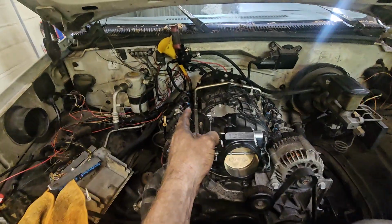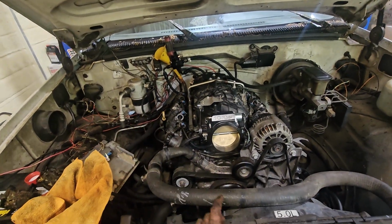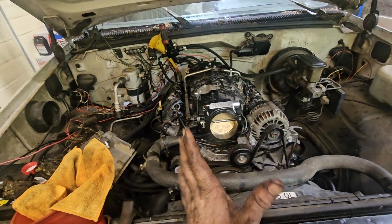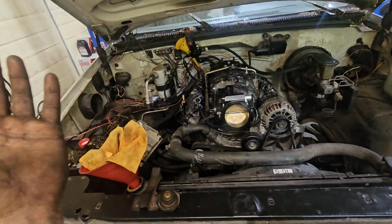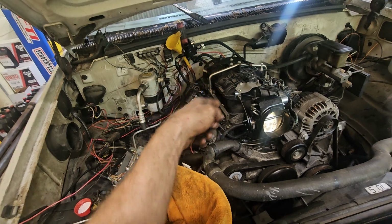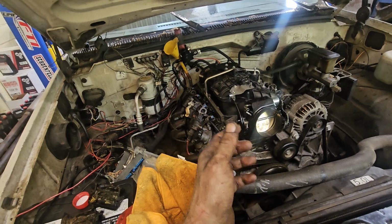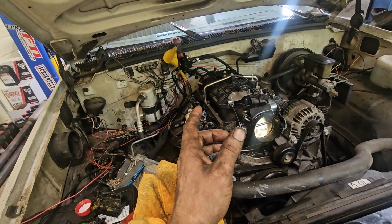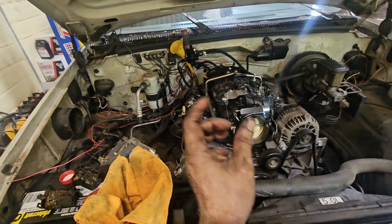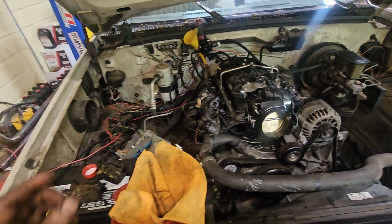That transmission dipstick tube is horrible. I forget which one it is, but this is the second time I've bought it. It fits the transmission great, but when you put the engine and transmission together, it's nowhere even close. And the bolt hole it lines up to on the bell housing, it doesn't even use that bolt hole. So I had to cut the tab off and bend it in the vise, and then get a new piece of metal with a hole in it to bolt to the cylinder head, an L bracket, and then weld it to the tube to get it secured.